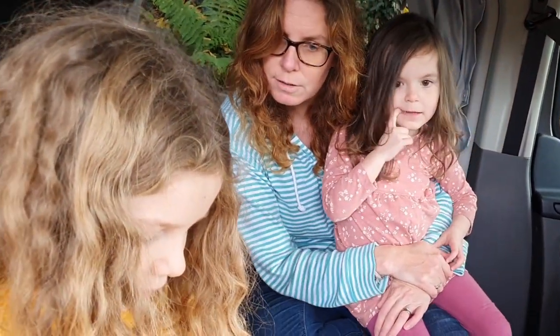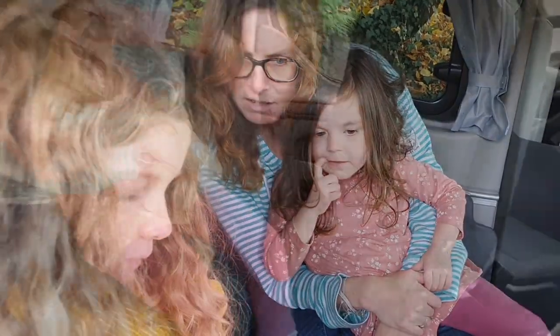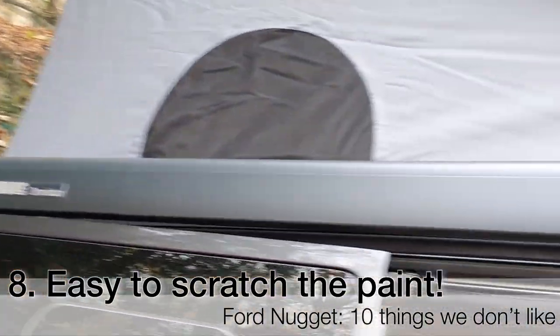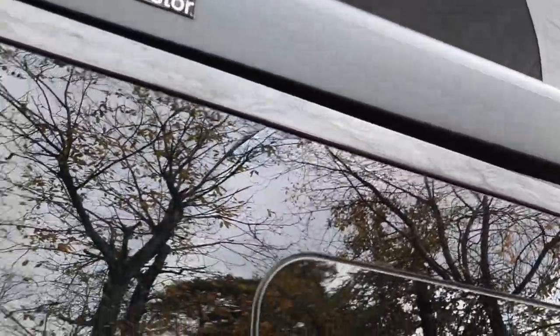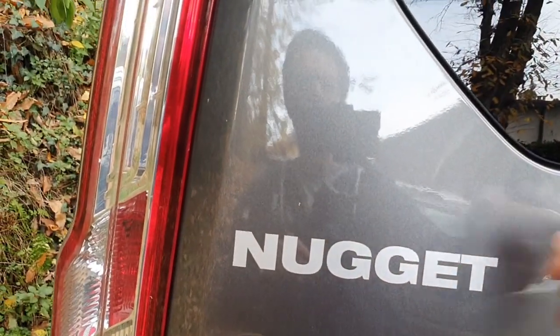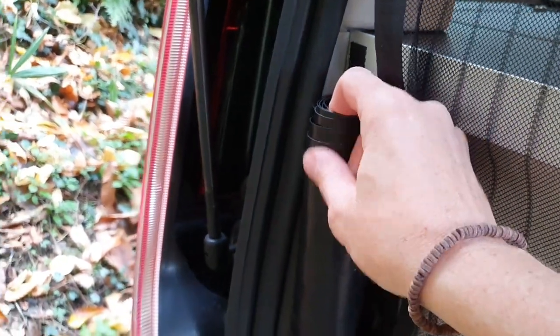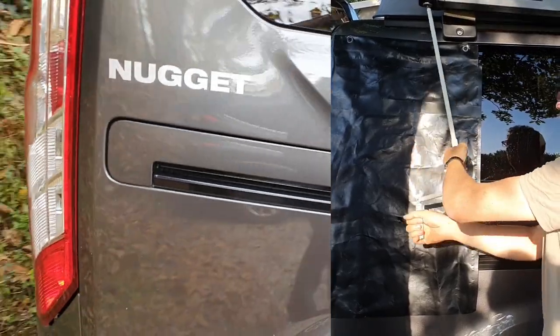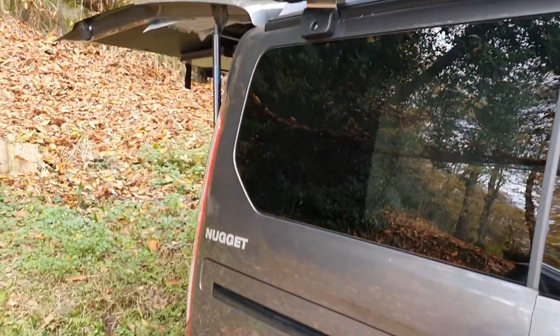Number eight is catching the shade — the awning. When you put the handle in to wind the blind, it has a metal end that comes really close to the bodywork. We've actually made a roll of old tarpaulin with suckers on it that we stick to the window when rolling the blind in and out, just to protect the paintwork. It's very easy to make a mistake and scratch the paint.